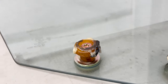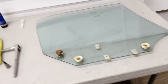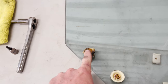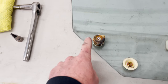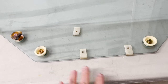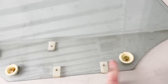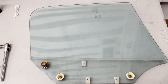Since you're going through all the work to clean the window sliders, might as well clean the window and the bushings too. This is the only bushing that goes through the actual slider — the other two are just stoppers, which is why it's all nasty with lube on it. If yours is in really bad shape you can get a brand new one — I'll put the link below, straight from Amazon. To clean the window, these just unclip from the back side. There's a 10-millimeter, another 10-millimeter, and a T30 Torx bit.